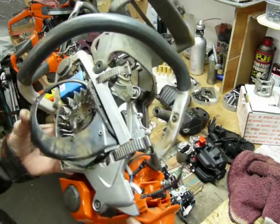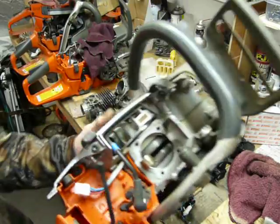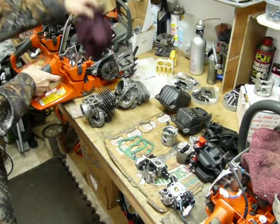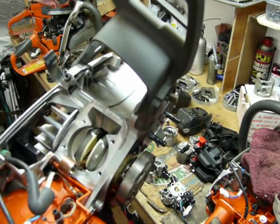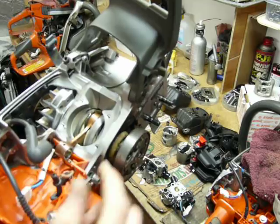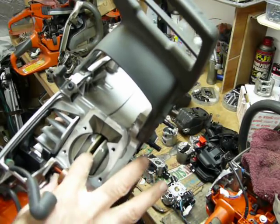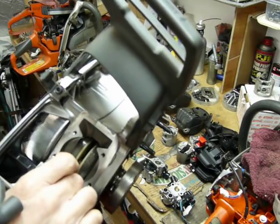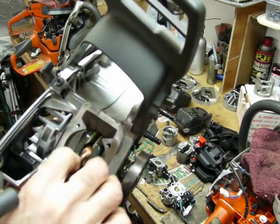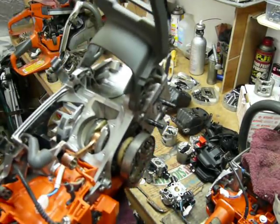Metal flywheel, auto tune. So we have 2 magnets on the crank that are used to monitor the speed of the crank. That's how we're metering the fuel. If we look in at the 562, same basic design, same 2 magnets on the same metal flywheel concept. We call this, like I said, a full circle crank, but they're metal caps with some nylon pieces that are molded to fit inside there that butt up against the bottom of the throws, come around on the top. But they both have nice long rods for what we're dealing with, which is sweet. The longer the rod, the better your dwell time is.